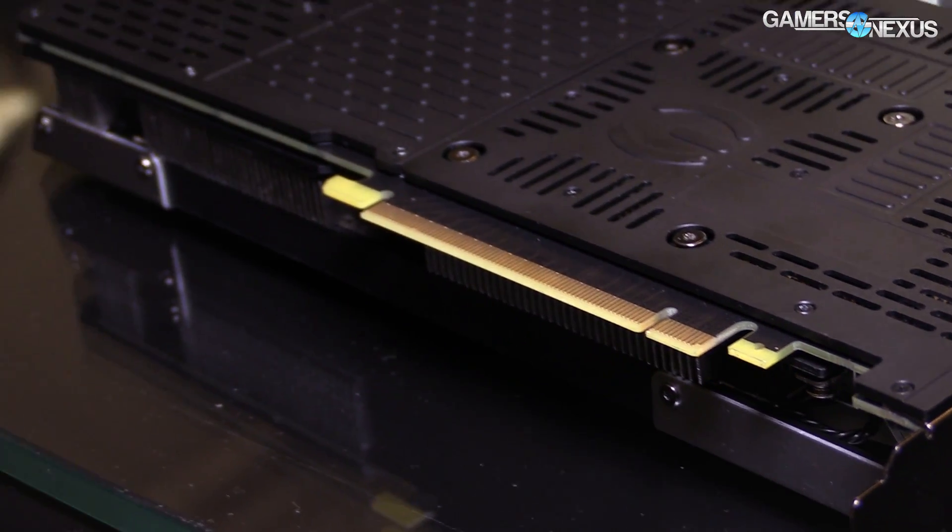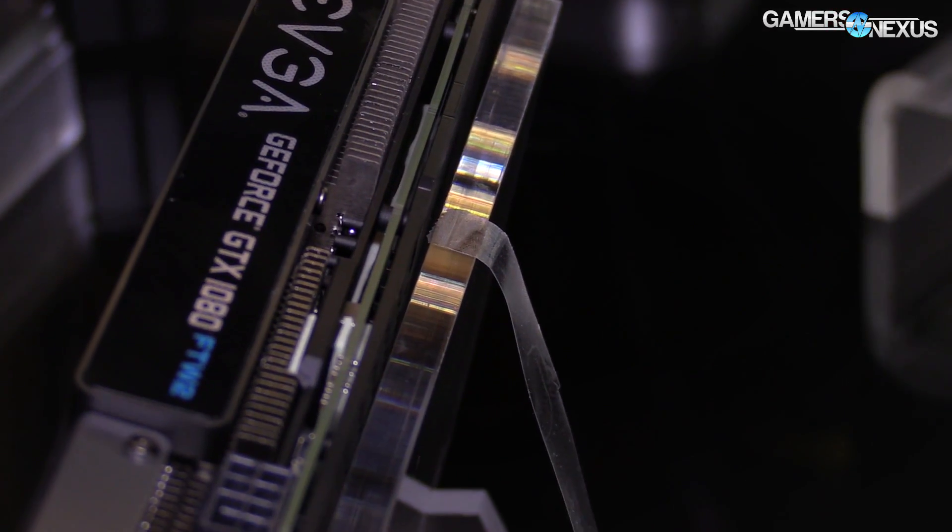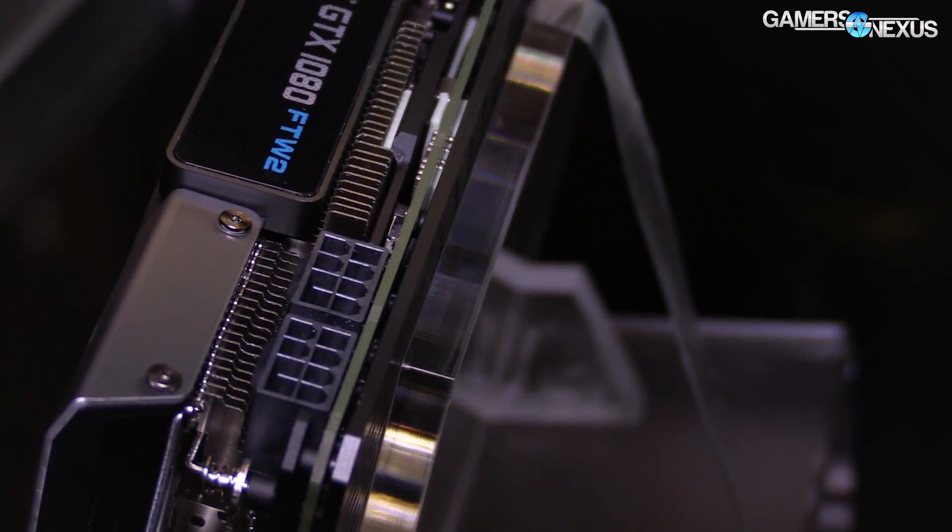And in the middle there's more of that. If you look really closely, you can see there's a protrusion from the base plate — either aluminum or nickel-plated copper, just going off of vision — that protrudes down and contacts the VRAM. That's a bit unique because you don't generally see the GPU cooler from most vendors cooling the VRAM actively by contact. At best it's a thermal pad, but that's not really that common. That will make the GPU diode temperatures look a bit higher because it's cooling multiple devices, but overall your experience is better because the GPU diode temperature only needs to be so low before you're concerned about other things.